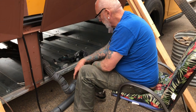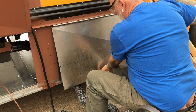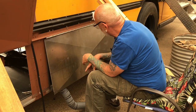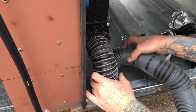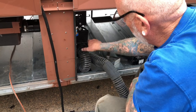Shelly's asking me about the sewer dump. I said, well, if we're in an RV park we can just do it like that, but she's not real big on critters coming into the under bay, and I think that's a valid point. Originally I wanted to make another door on this door right here, but that's not going to work because of where the latch has to be. So I think what we can do is go through the floor right here. If you look in here you can see the hose down there — you can actually make that corner and go out the floor.